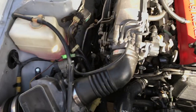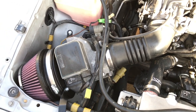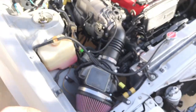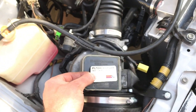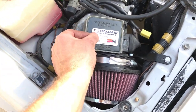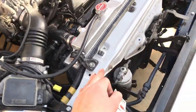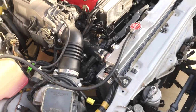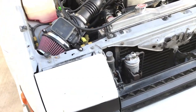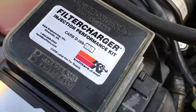I'm going to tighten up this hose and then we'll get some sound clips. We'll see if there's any improvement in the whoosh department. Almost forgot this really important guy — this is the CARB ID sticker. I'm probably going to put it right here so that when I do get a smog inspection, they're not going to ask what that modification is. I would put it on the chassis somewhere, but when the car gets painted some of these bars and supports will also get painted and I don't want them having to remove it. So this seems like the most logical spot — and there she is.